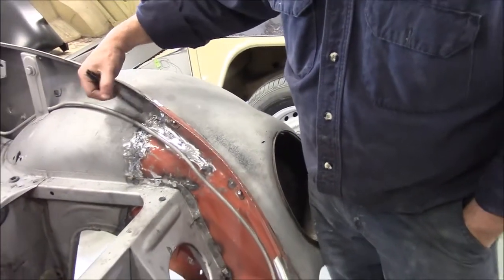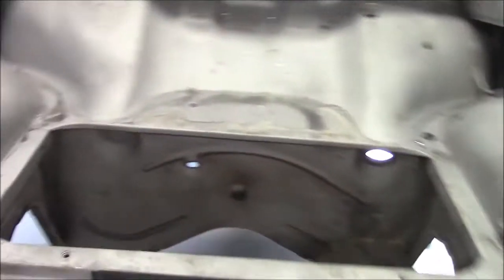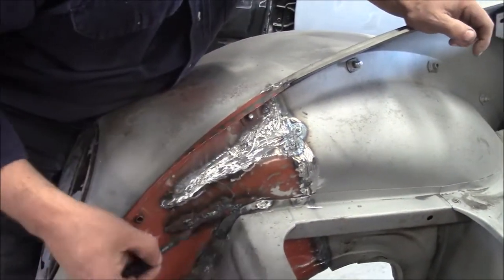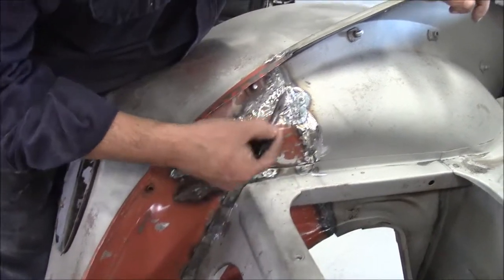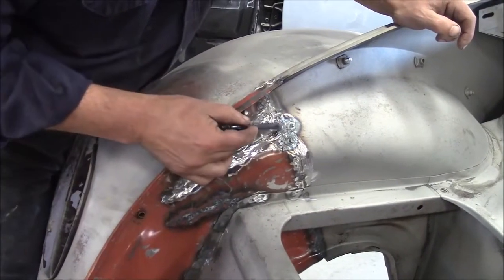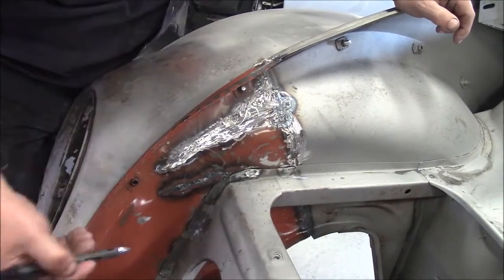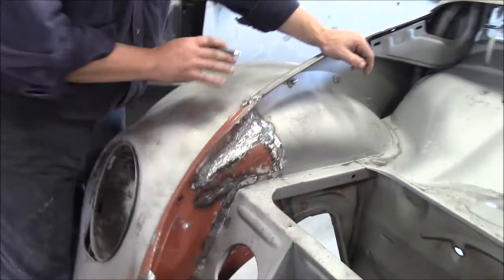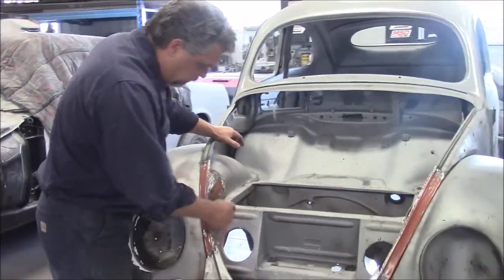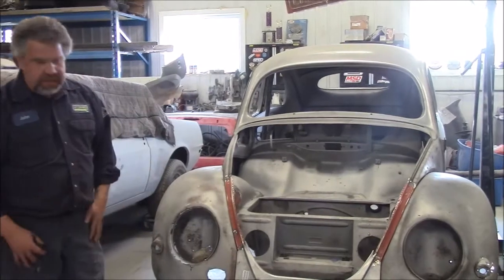We put it through our English wheel and then welded it in so it all becomes an original look. Same thing if we look at the passenger side at the intersection — you can see the same thing. We still have some grinding to do, but you can see where we had to modify things. Basically we cut pie-shaped sections and then welded new pieces in and obviously modified it here also. Later on, after we finish the grinding, cleaning, and smoothing process, no one will ever know the level of fabrication or modification that had to take place to make all of the cosmetic stuff look nice.